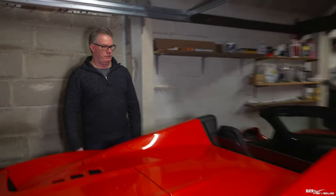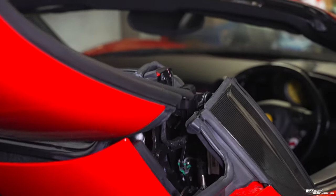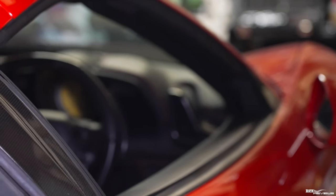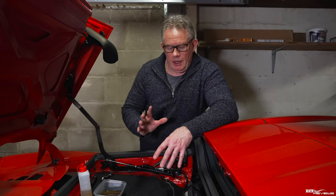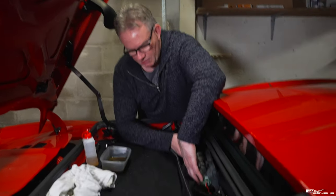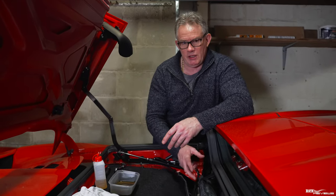I'm going to cycle it again to close it. Changing the hydraulic fluid has made quite a substantial difference with regard to the smooth operating of the rams and the whole hydraulic system - that's quite a substantial improvement and I'm really pleased with that. After I topped up the reservoir, I cycled it through a few times and it was a hell of a lot smoother. When I checked the fluid in the reservoir it was dirty - the new hydraulic fluid put in the reservoir had circulated through the system.